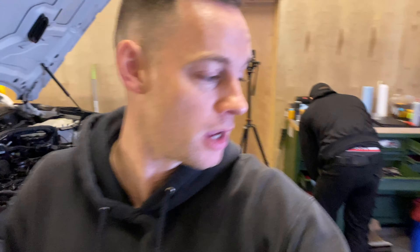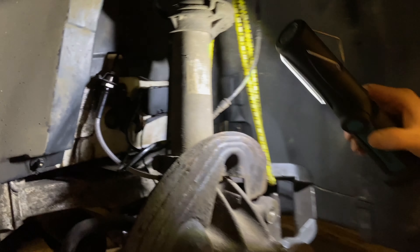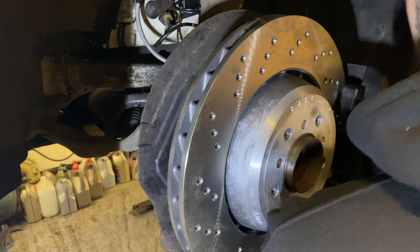All the hard lines have been refitted with brand new OEM parts from BMW - here are the old ones looking a bit worse for wear. They were a bit of a headache to fit. You can see the new lines fitted: the blue nib on the driver's side and on the back the passenger side. We've also fitted all the braided lines, with nice fresh BMW hard lines replacing the corroded ones. Now we're fitting the discs and pads - discs onto the hub, Ferodo DS2500 pads into the calipers, then bolting the calipers back on.